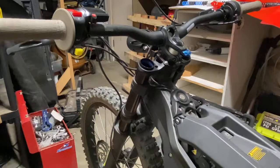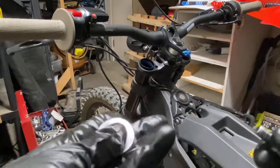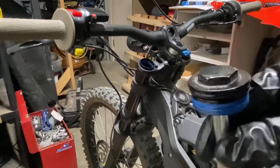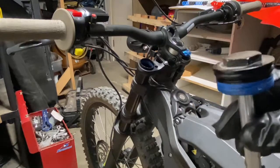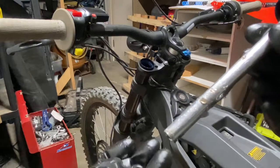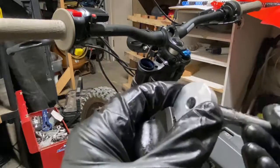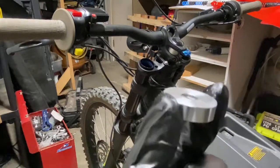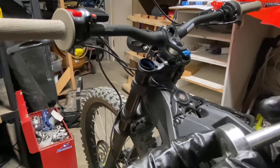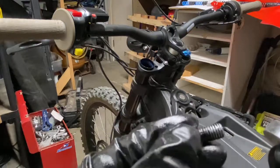So I discovered the culprit. This bolt was at the bottom of the left fork tube. When I took the left fork cap off, I right away noticed this plunger didn't have anything at the bottom of it — it's supposed to have this cap. It was sitting on top of the fork, this kind of spacer cap, but it should be fixed here via this bolt.